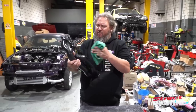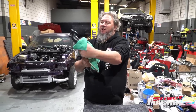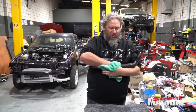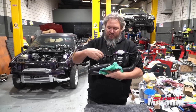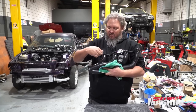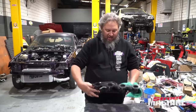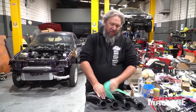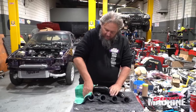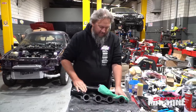It's good for like 1300 degrees, I believe, Celsius. It's a little bit damp at the moment because we got them coated before we drilled all these holes. So I had caps on here, got coated, and then after the coating was done, pulled all the caps off, and then I drilled the holes for our thermocouples. And obviously had to use some lubricant in there to aid in that. So just wiping the excess lube away.